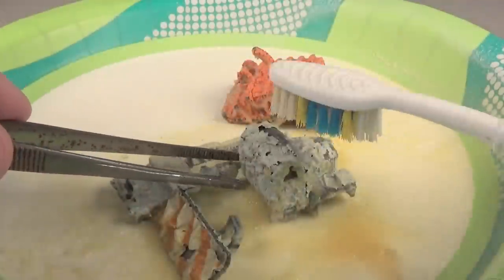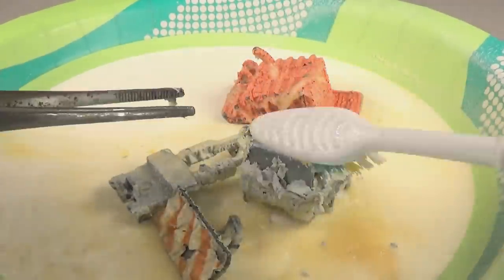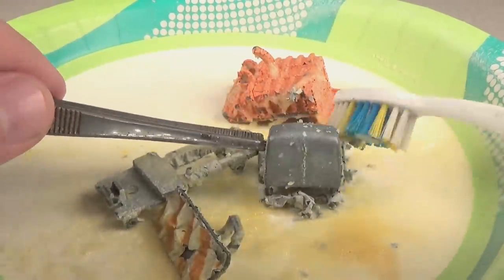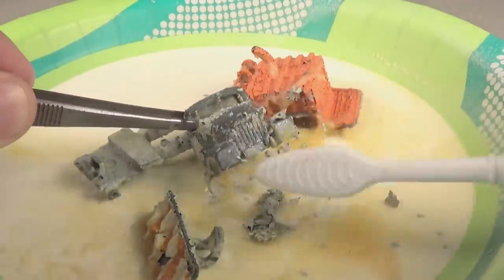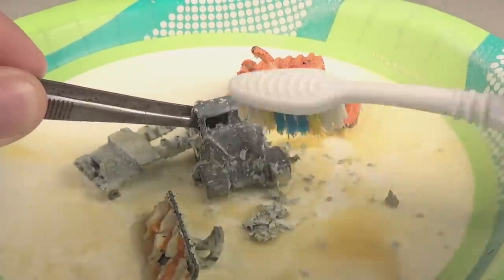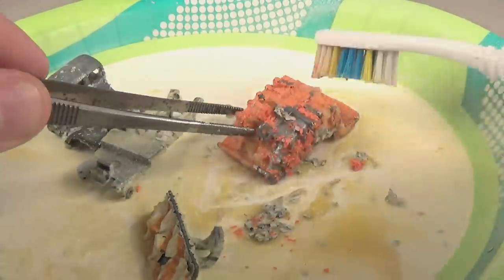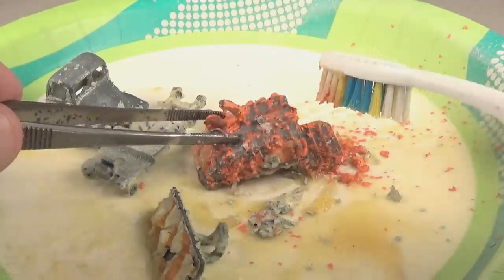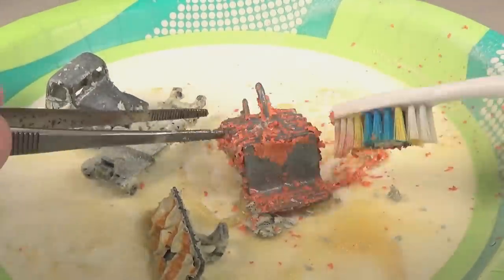Now I can go about removing the paint. I'm using the new aircraft paint remover, the one without methylene chloride. This is due to several tragic cases of not reading the label, and why we can't have nice things. But it works okay. I still have about a fourth of a can of the old, so I'll set that aside for jobs the new stuff can't cut. Just in case nobody's told you, you should only use paint stripper in well-ventilated areas, and you should read the labels on chemicals before using them.